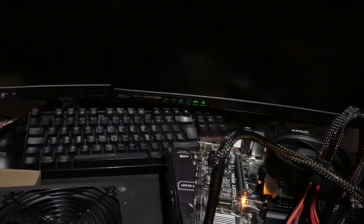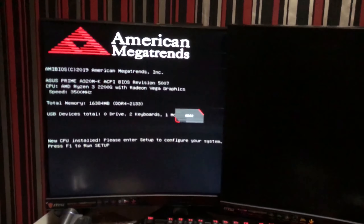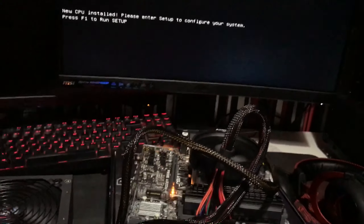The last thing I have to do is just jump these cables — there we go, it's on. Both fans are spinning, we should see a POST in a minute. It's probably going to turn off and turn back on just to train memory. The keyboard's on — that's a sign. There we go, it's on the monitor, so I'm just going to quickly switch around the cables, but we do have a POST — let's go!